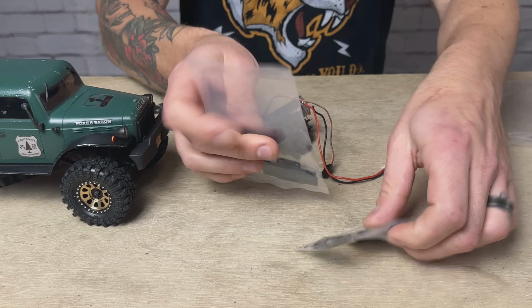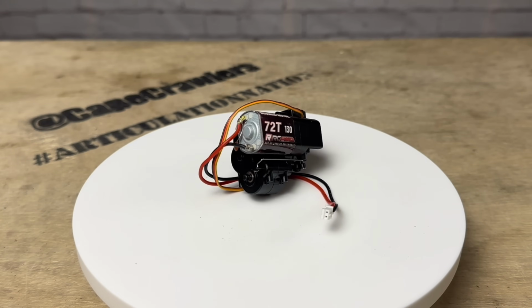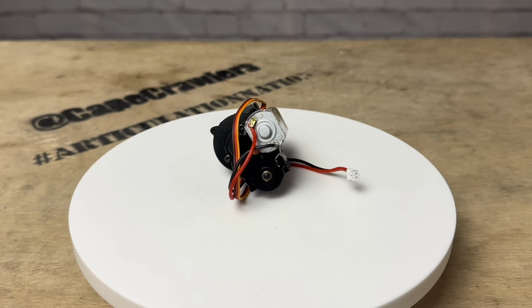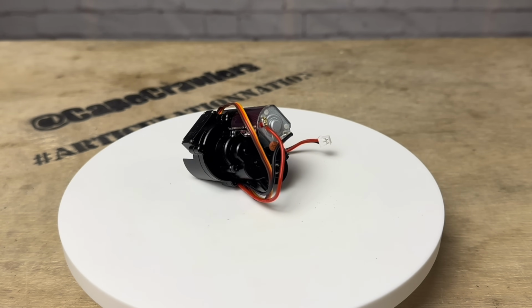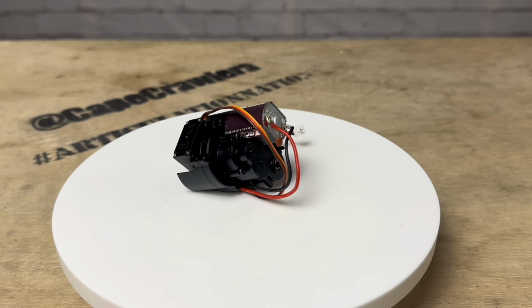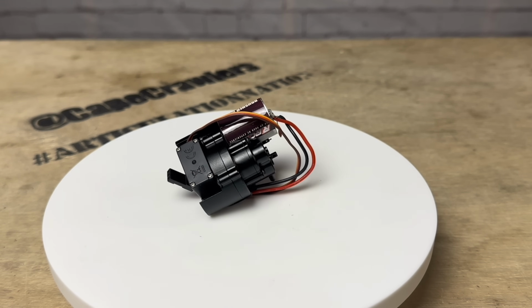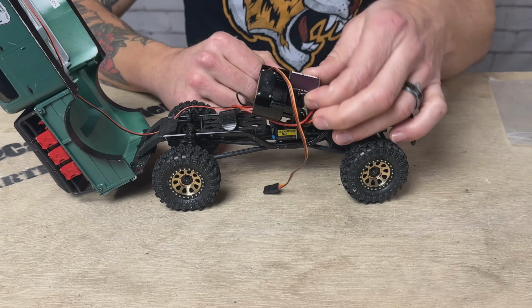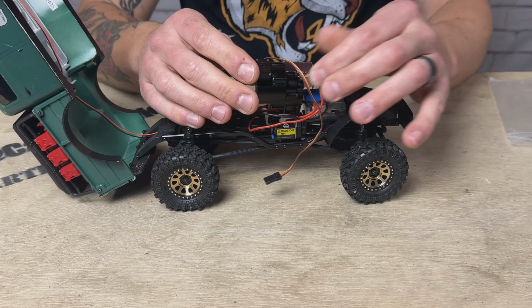It's very cool. RC All-Wheel Drive is really thoughtful with their upgrades. I don't know the exact ratio of the gears in here. I do know that it has all metal gears inside the transmission. So looking at the size of this thing, look at it compared to the stock drivetrain. Holy moly, we are going to have to do some serious modifications here to get this to fit. Looks like a front facing is probably going to be our best bet right there. And it's looking like stock drive shafts will fit as well, just eyeballing this.